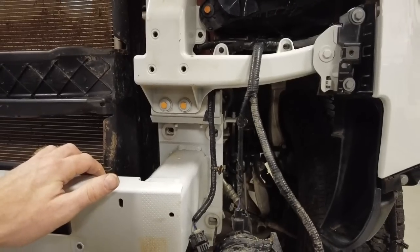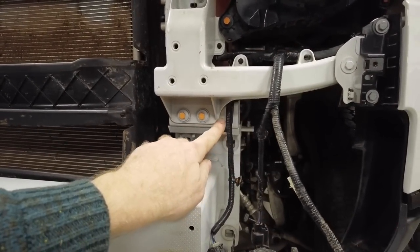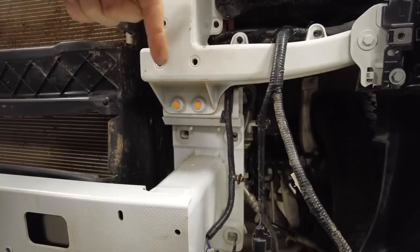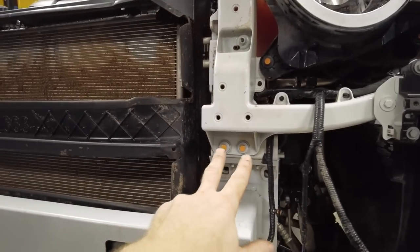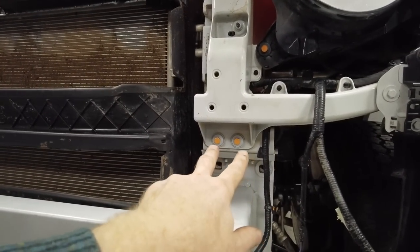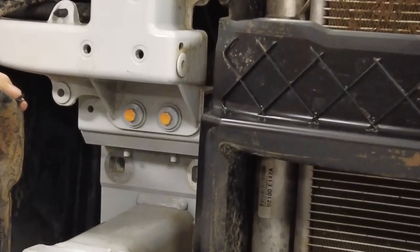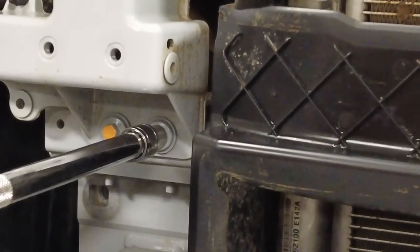Right now. Right, so we're nearly there, but we're connected. Somehow this front panel is connected. Now, we could either do these two bolts that come down in behind here, but they're kind of tricky to get to with the headlight and everything in the way. I think if we undo these two front ones here, and those two front ones there that we've coloured in orange, I think we'll be all right. So they're 10 millimetre. Let's try that, Tyler.